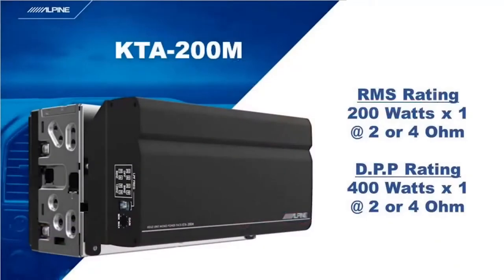This 200 watt RMS mono amplifier can deliver a true 400 watts of power when needed. These amps are very efficient. In the case of the KTA-450, if your vehicle head unit constant wire has a 20 amp fuse, you can get the amp's power right from there. If it has a smaller circuit, we suggest running a 10 gauge wire for power directly to the battery. Since the KTA-200M draws a little more current consistently, we suggest running a 10 gauge power wire to the battery every time.